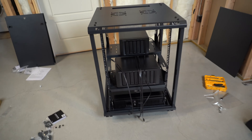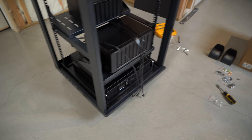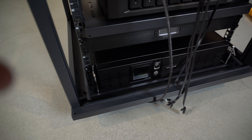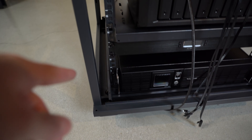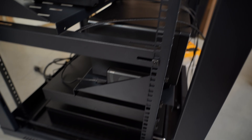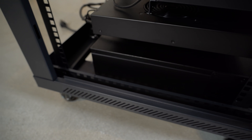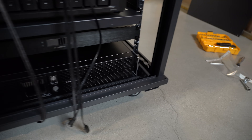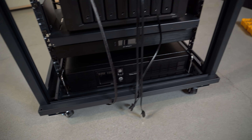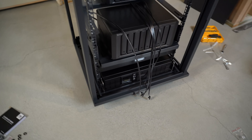I've assembled this to a point where it's ready for the Ubiquiti gear. I've had a lot of trial and error setting up these rails. With the UPS at the bottom, it is super heavy — I tried to mount it utilizing the rails but it bent them because it's way too heavy. I ended up moving those up and adding some additional shelving to this setup. The UPS is now laying flat at the base of the cabinet and has been attached using cage nuts just to hold it in place, not being supported by them in any way. I recorded a ton of me assembling this thing and I'm going to scrap all that and just jump to this point.